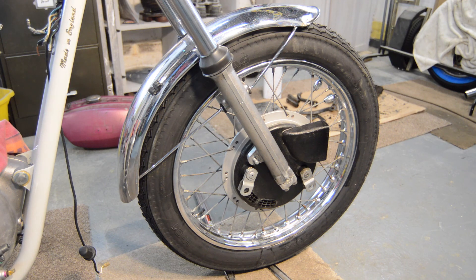So the final things I'll do now is put the brake anchor nut on with the large washer, and then adjust up the front brake so I know the shoes are where they should be before I start fitting the cable - hopefully in the next video. The handlebars are on the way allegedly, cables and grips as well. I'll build that up which will enable me to put all the wiring in place. We will then have a complete bike apart from the finishing bits of the engine. All good stuff.